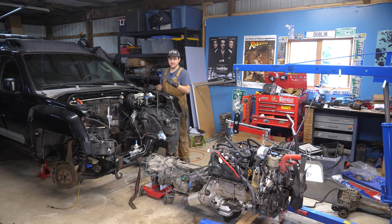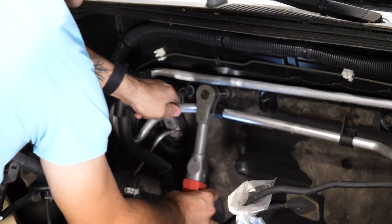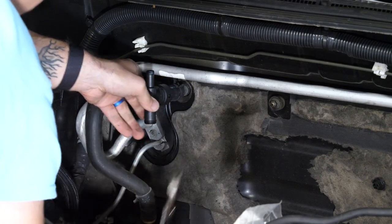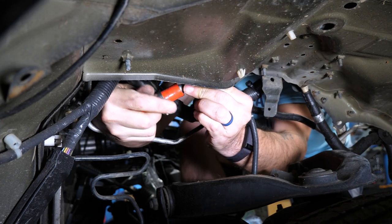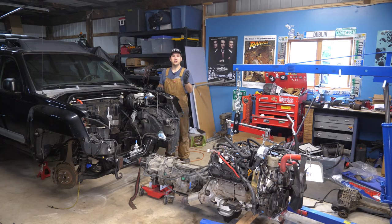Because the last thing I want to do is deal with that once the engine's in. I also went and installed the two items we purchased in the last video — that'd be the heater core fitting. We took the old one off the back of the engine bay, which was really nice to get out of there, and installed our new piece. The bottom is going to go to the engine and the top is actually going to go to the overflow tank. You can reuse your old hose, but I had Angel from Off-Road Gorilla send me the pre-cool hoses that match the rest of my radiator hoses. They actually make kits specifically for VK swaps into Xterra, so if you're interested, go ahead and look in the description below.